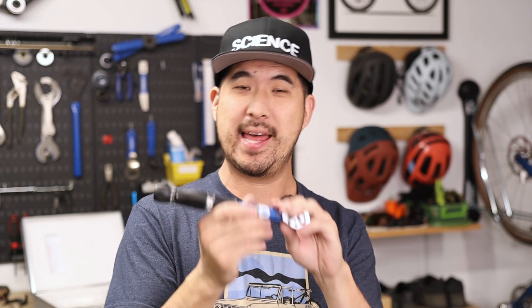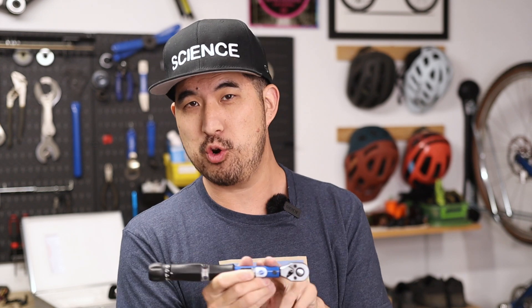Now whether or not you agree with this science, there is one thing we should all be agreeing on: for length-dependent click-type torque wrenches like most of those we use in the bike shop, it actually does matter where you hold the handle. I'll link a video down in the description where I've shown using the same strategy here that where you grip the handle of the torque wrench can actually vastly alter the amount of torque you're going to apply. That idea is super counter-intuitive, but if you don't believe me, just check out that video — it does a pretty good job explaining it.